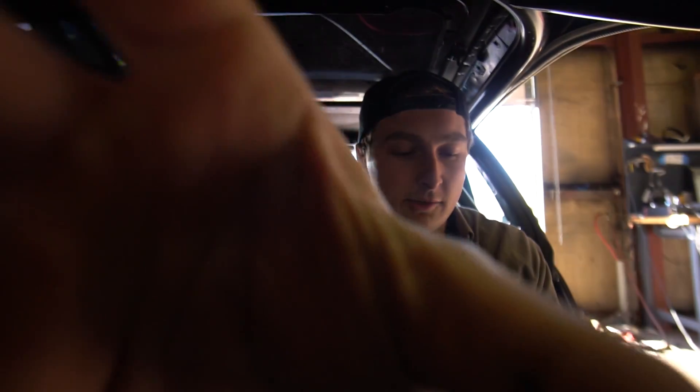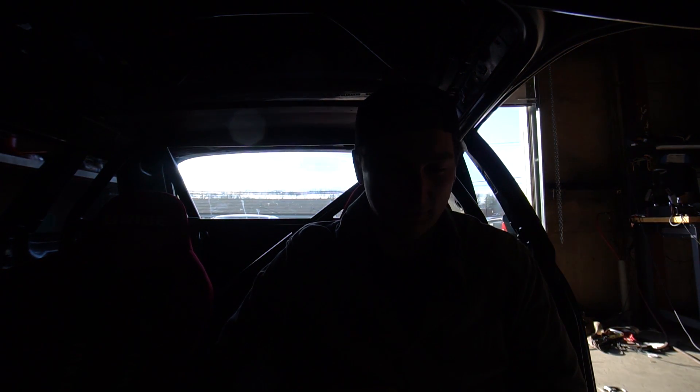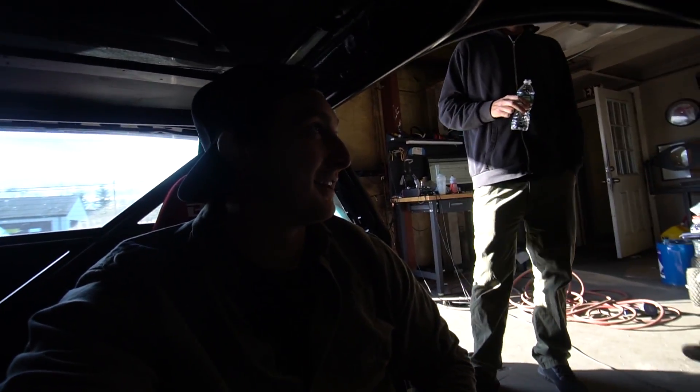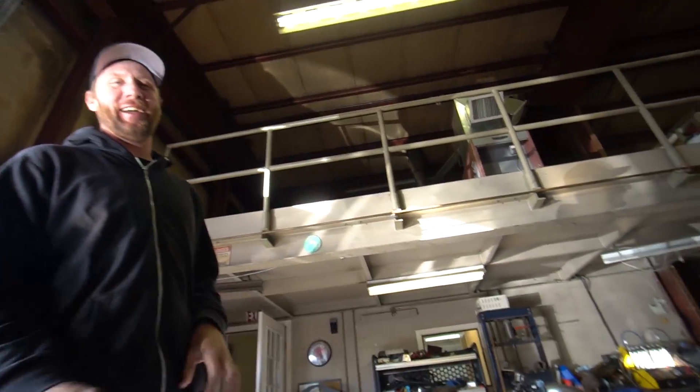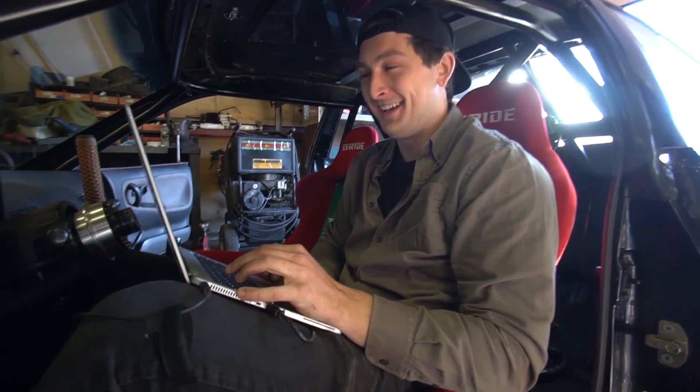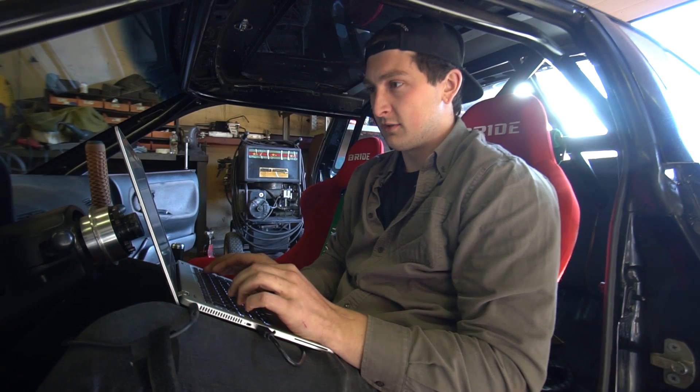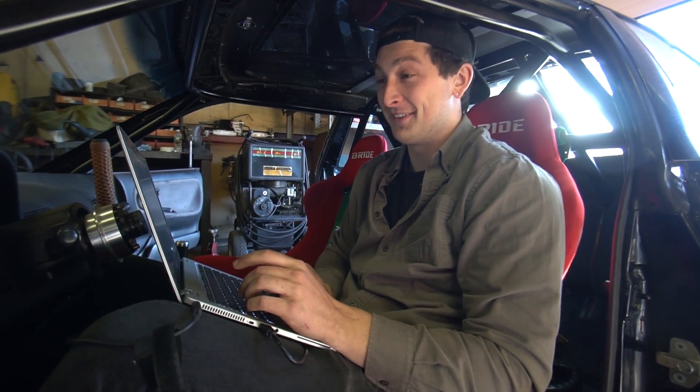We've got to rescale the maps. We said we'd put it on 30 pounds — these are stock head studs. I know 30 PSI sounds high, but we're making 460 horsepower. Now it's time to clean the fuel up because we've been throwing a lot of sauce at her. We cleaned the fuel up a bit more — we didn't even have the cells on the map for this higher boost level, so we just had to make the cells, put in numbers we think will work. We've got to take the boost cut off and make it really hot, which is scary. 30 PSI boost cut.